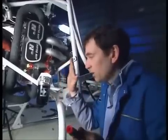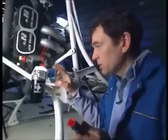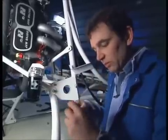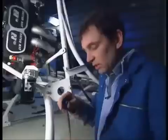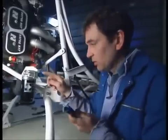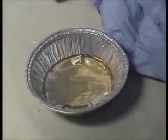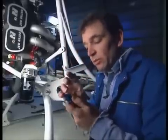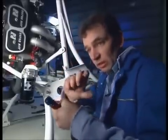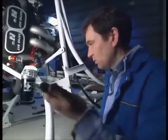I'm going to connect up the oil filter here, which is a disposable cartridge filter, to the bottom of the engine — two pipes. There's an in and an out on the oil filter. When you connect these oil pipes, you take out the protective end caps, and then they need a little bit of oil smeared on the threads inside, and also the threads where they connect to, to stop the aluminium galling — that's when you get a little burr that might form. Because it's quite soft aluminium, when you grind the two together it'll create a groove. Just a little bit. This one is the out one.